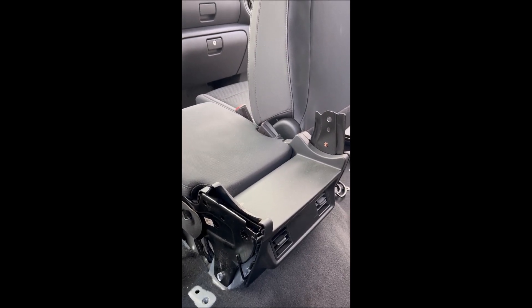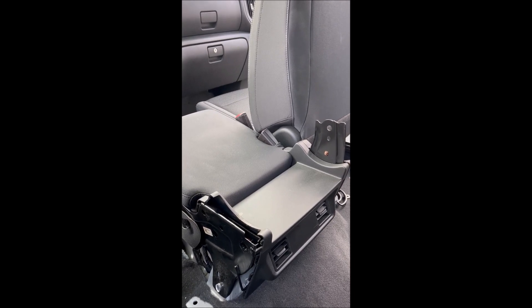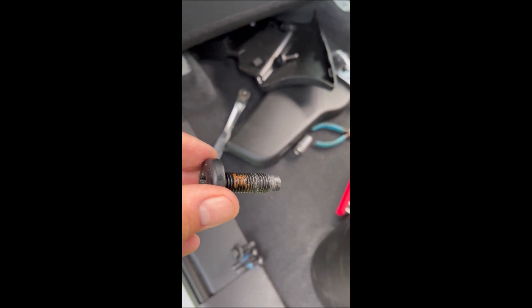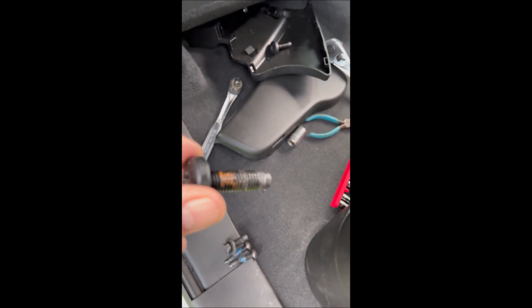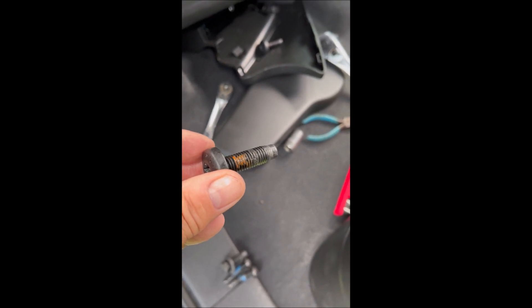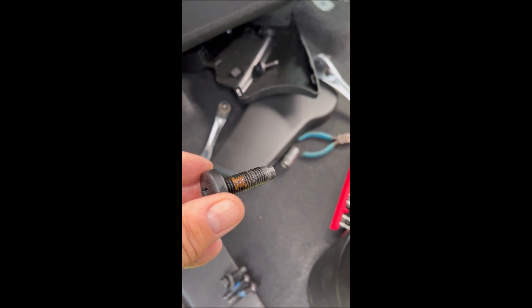The original is removed and we're ready to replace it with the new one. A couple of comments: the original fasteners have Loctite or a similar locking liquid on them from the factory — some are red and some are blue. Blue is rated for removable, red is a higher strength. You may want to follow those original instructions and apply Loctite or something similar when putting the bolts back in.